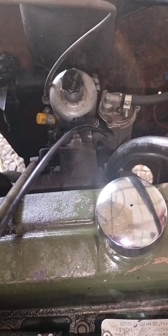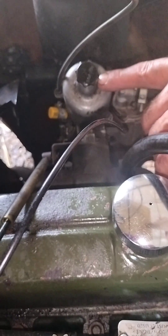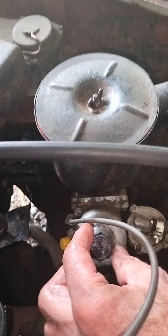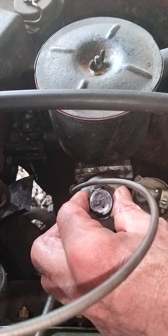Checking the oil level in the carburetor dashpot on a Morris 1000. Go to the oil filler cap — here is the dashpot. It should never be tight; it should just be screwed finger tight. Undo it, and you've got to be gentle pulling this out — let it come out nice and easily.